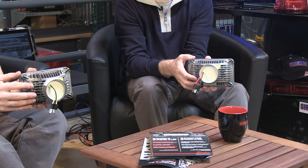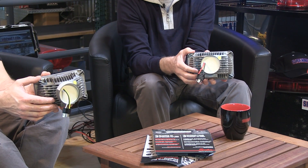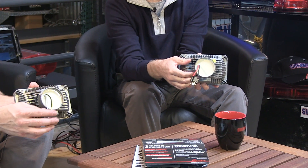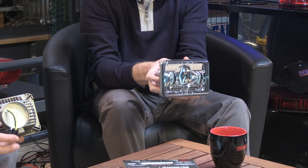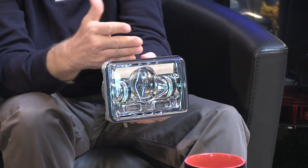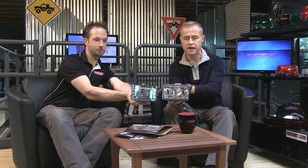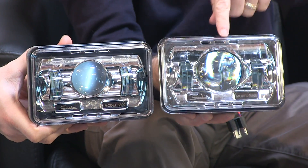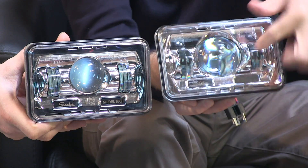They have a cast aluminum base at the back here. Fully potted — so in other words, no moisture is getting inside here. The difference between these lights essentially goes as follows: this particular one in my hand happens to be the high beam one, and the one in Chris's hand is the low beam. They look identical, but there is a difference. If the camera can zoom in, you can see here in the high beam center area we have a different size. You can see it there.